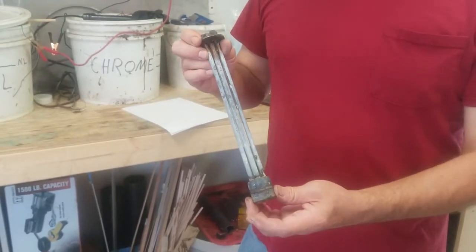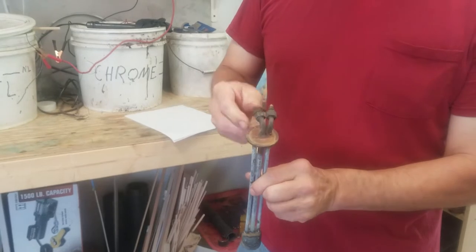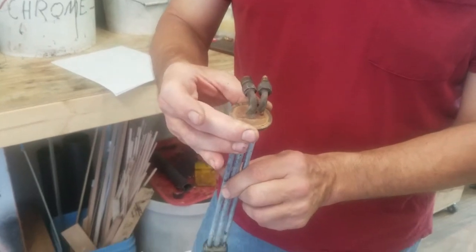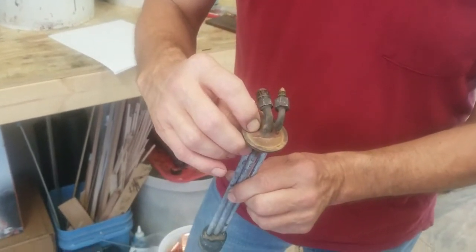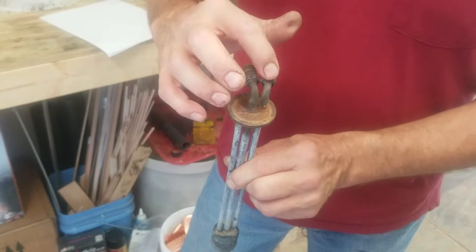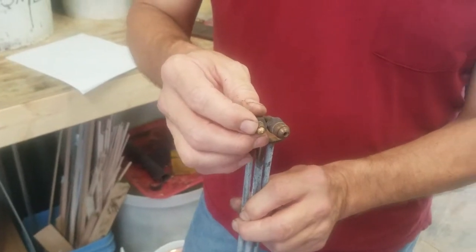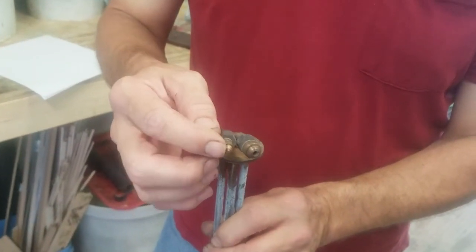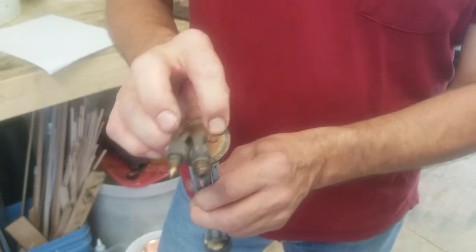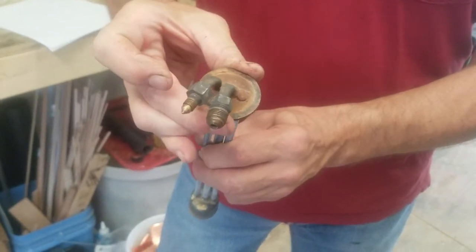The first thing we're going to do is get to how it works — I'll explain it and then draw it in a moment. If you look at the top, there are two tubes coming out of a circular, fairly thick steel plate. There's actually a third tube mounted in here but it doesn't come out the top. The center tube is a 5/16" fuel pickup. The outside tube on this side is a 1/4" tube reduced down on this end to 1/8", which is going to be an air line going to the gas gauge, because this gas gauge works on air pressure. The opposite tube, which doesn't come out the top, is also 1/4".